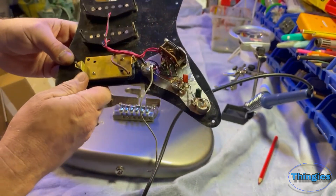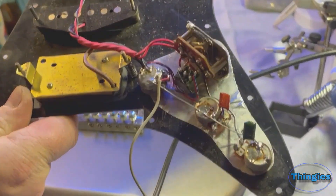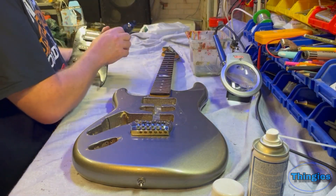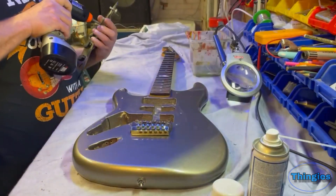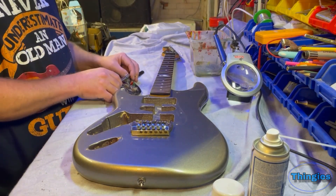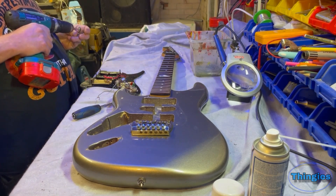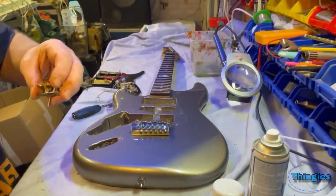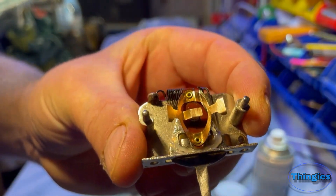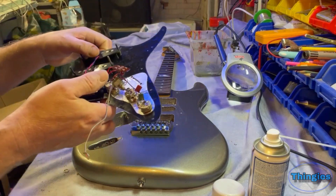I'll have a good look over this now and think about what needs doing whilst I go to Gateshead - there's going to be a six hour round trip for me to do. I decided I'm going to take the gear selector switch to pieces and give all the contacts a bit of a clean up and give it a bit of a greasing because it's proper crackly. Now that's an old looking switch, but fortunately the old ones you could clean and maintain them. I'm not so sure the new ones do that - you probably need an app to operate them.